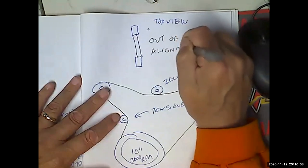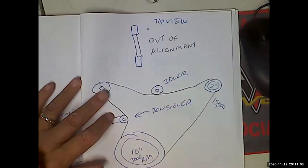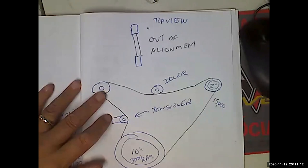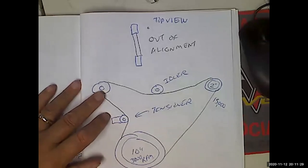Chuck, have you seen a vehicle that had this problem in the last 30 years? Yeah, me neither. That's why I don't want to spend too much time on it. Old school stuff, especially if it's been replaced engine by some hack. Yeah, that'll happen. A bent bracket, something like that. Very, very common to have alternators that are supposed to be aligned like this, but they're aligned like this instead, especially when some hack has put in a new motor or a used motor, whatever.